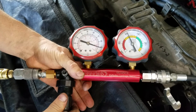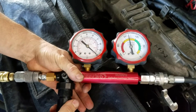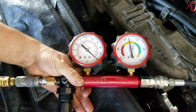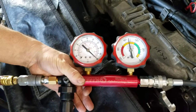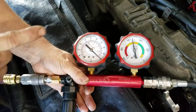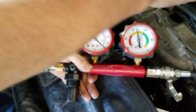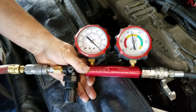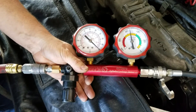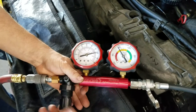Slowly go up to it. Okay, we're at 100 psi and we're at approximately 53% leakage. What that means is this engine is not going to be balanced through its firing order — this cylinder works against it because it's going to be dragging. Is there anything further to videotape at this point?